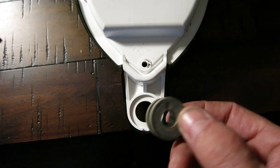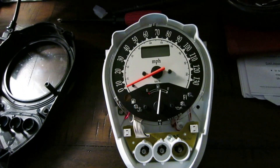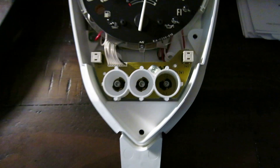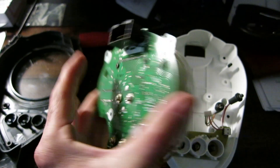There's a series of screws you have to take out, and then there is a rubber grommet that sits here that you need to pry out once you get that apart. There's the cover with the glass on it — we'll get that cleaned up. Next I have to take this cover off; there is one screw back there that might be holding it. That one screw holds the assembly together — take it out and you can remove the cluster. There is a bulb you need to remove and two connectors — be very careful not to break the pins.